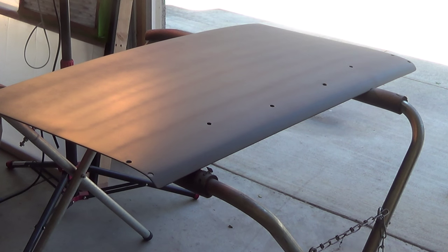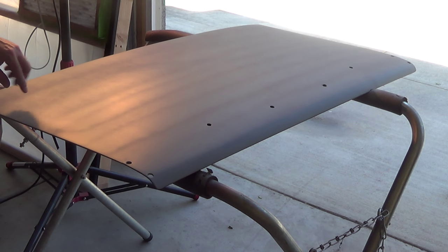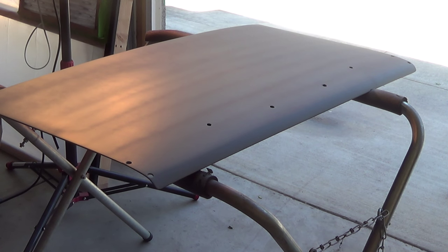Just about nothing went well with that. As you can see in the camera, both of those coats striped pretty hard. I don't know what the problem was there. The first coat was just laying way too much material on. It was like gigantic ripples of primer over here. So for the second coat, I dialed down the fluid quite a bit to try and get a cleaner pattern.